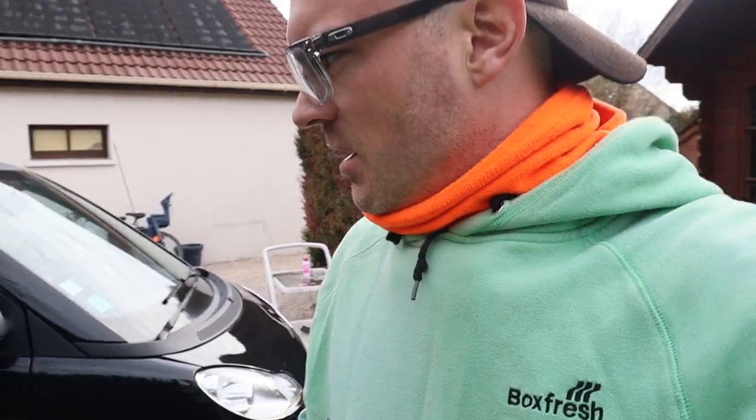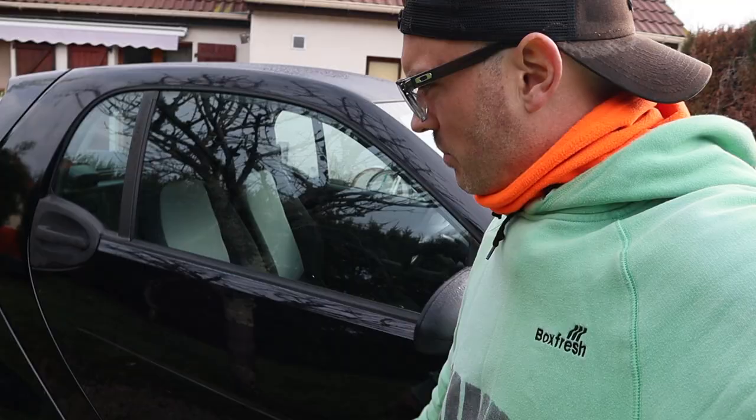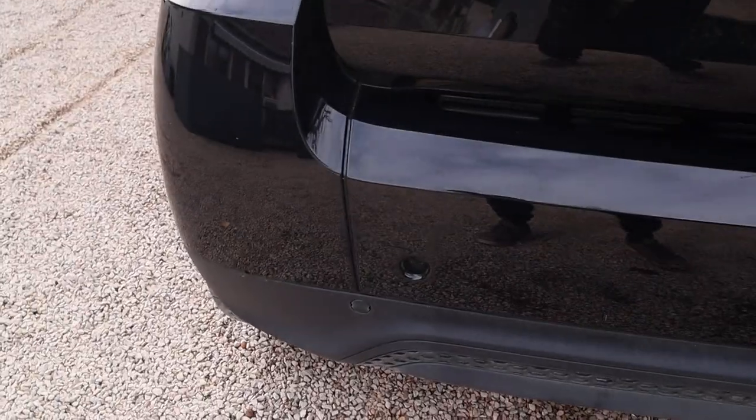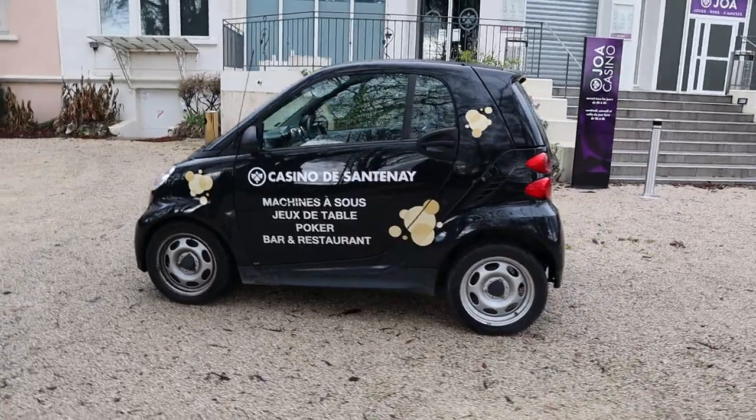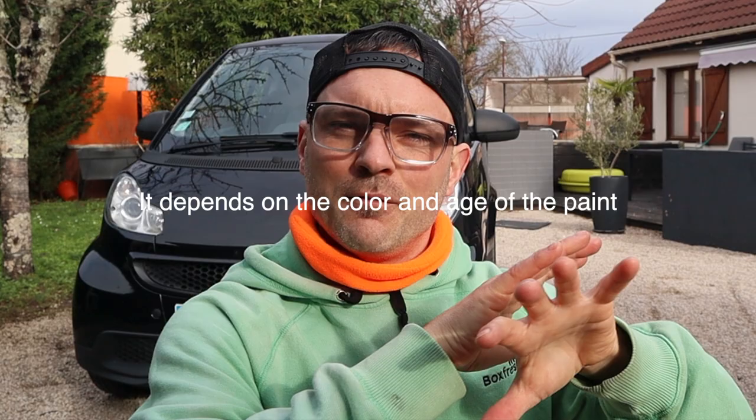I've been around the whole car and there's only a tiny bit left. I'm actually quite impressed — it's pretty hard to see where the letters have been, and that's maybe due to the fact that it's got this weird plasticky stuff and not normal paint. It's looking pretty good. Now if you were to do this usually on a car, once you remove the publicity or the graphics, you would have to renovate the paint completely — worst case scenario giving it a good wet sand with a really fine grit paper and then fully polishing out the panel so all the paint is at the same level. I've kind of gotten away with it a bit, this car being plastic, and yeah, I wasn't expecting that, so that's a plus point. I'm going to give it a quick polish and the outside should be done.